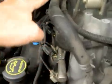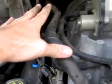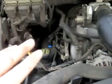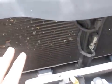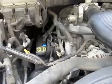If you're sitting in traffic and your car starts to overheat, turn the heater on. Inside the dash, these heater hoses carry hot antifreeze into the dash of the car. Inside the dash is a small radiator called a heater core. If you're running hot antifreeze into the dash, turn the fan on high and you're blowing air across that little heater core — it acts just like a small radiator. It should help you bring the temperature down so you can pull off on the side of the road and get some help without burning the motor up.